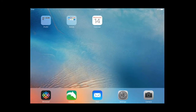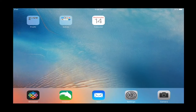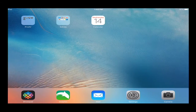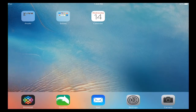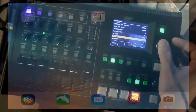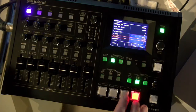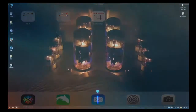When I go to horizontal size I'm going to stretch until about 150, which is roughly where I need to be. Then vertical size I'm going to be around 112 — you can see at the bottom it starts cropping and I don't want that. Now I have a really nicely scaled HDMI input four, so when I toggle between three and four you'll see it's beautifully scaled and ready to go.